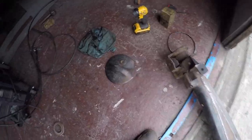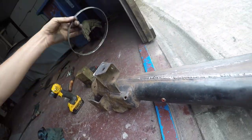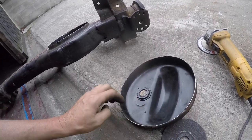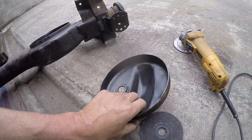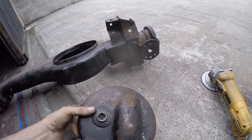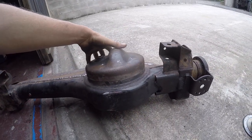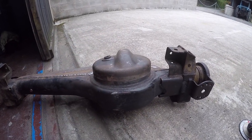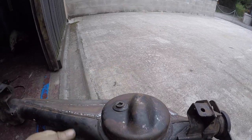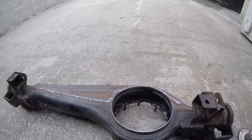So just the pan now. That's the old pan — it was all dinted on that bottom edge so I've just cut a bit more off that. I've knocked that dent out, and this is a pan I got off another one which I did years ago — I've just levelled all that off and I'm just gonna plunk that on there and weld it. It's spaced out a little bit — probably a bit too much actually, but better safe than sorry. I'll weld all that on and then might just do a bit of reinforcing at the bottom, put a strap over there. I'm just knocking all the studs through before I weld the pan on — makes it a bit easier as they're a bit tight.